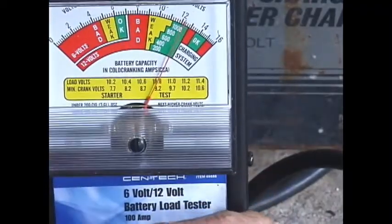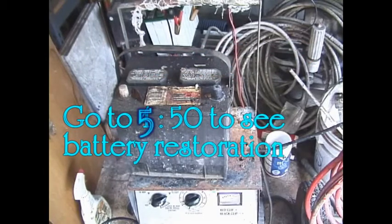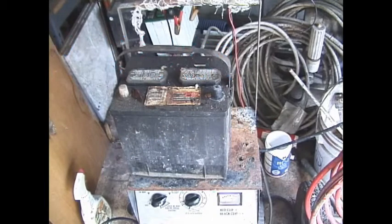The battery restoration. Chapter one: lead acid battery general information. In the average lead acid car battery, golf cart battery, or variations like sealed batteries, the standard electrolyte solution is 35% sulfuric acid and 65% distilled water. The acid works on the lead in the plates and causes electricity to be released when demanded. When this release occurs, it leaves behind a sulfation layer.